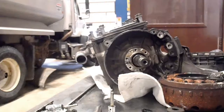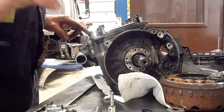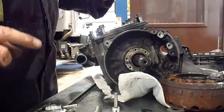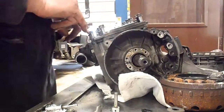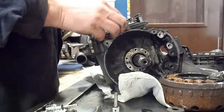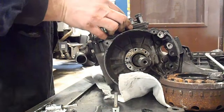These look okay, but when I split the block I'll be checking all that again - and of course I'll be filming that. It looks like I could clean some of these ports up. There's a bit of flash here and there that could be cleaned off. I've got all my bolts out. There are four 5mm hex socket screws at the bottom, then four T30 Torx up top - I took those out first. Then remove in reverse pattern from the outside in - these are 11mm. Then gently pry on a couple surfaces, tap with your screwdriver handle if you need to, and you can pop this bedplate off.